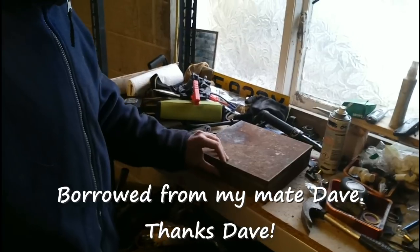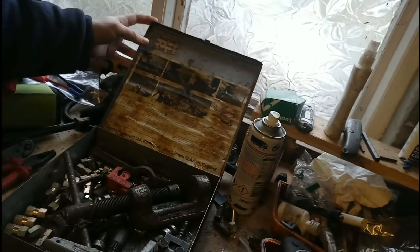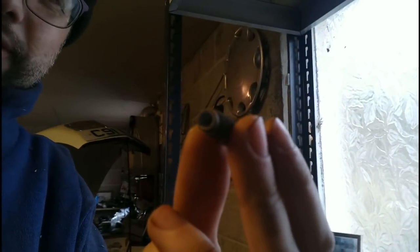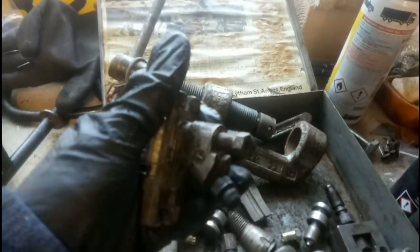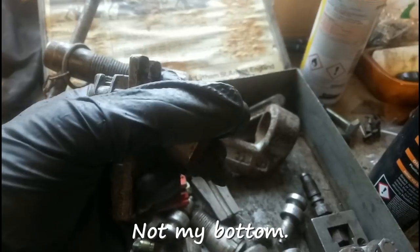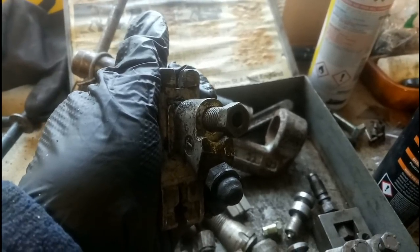One thing I do have is a brake pipe flaring kit — a really old one. So old I've got the thing stuck already. Sykes Pickavant. We've got all sorts of things in here. I'm hoping these are the right size brake pipe nuts to go in the wheel cylinder. So what I need to do is find the old wheel cylinder, because I'm going to bugger about with that. Sadly, that's not the right one — it looks like it's going to go in, but it in fact doesn't. So I have to order up the right size connector, which will delay things.